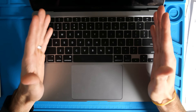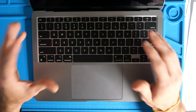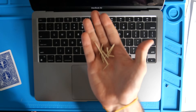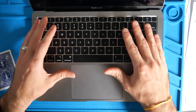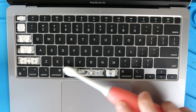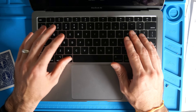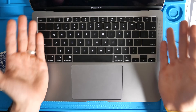A basic overview: we're going to isolate what part of the keyboard we need to work on, remove those keys using a playing card and toothpicks — and you are going to break a lot of toothpicks during this process. Once the keys are removed, you'll clean the key caps in water, then clean the keyboard with a toothbrush and some isopropyl alcohol. Reinstall the key caps and the crunch should be gone — your M1 Mac should feel like new.